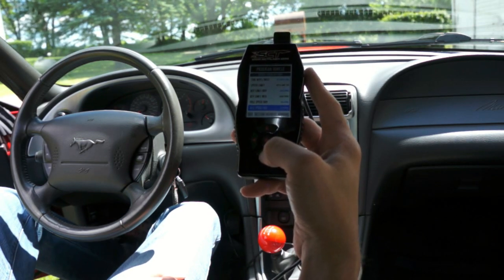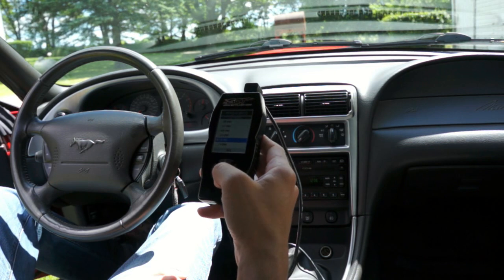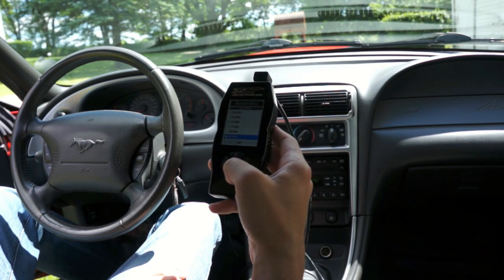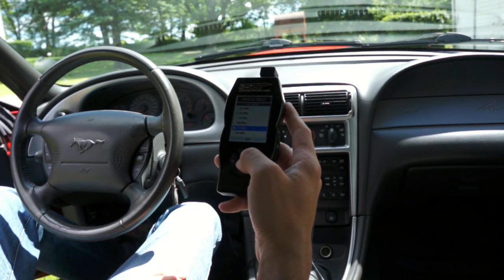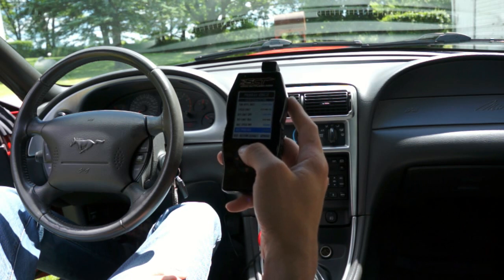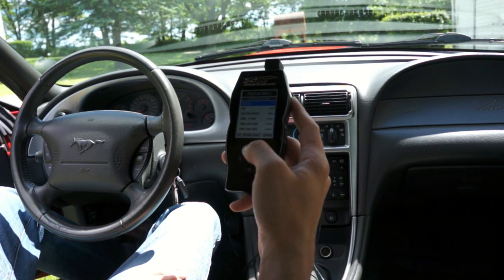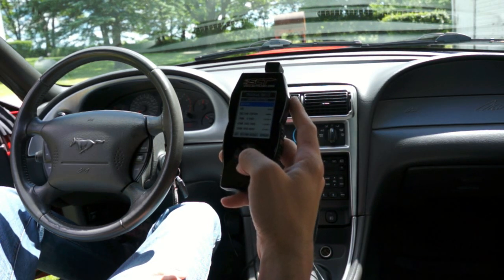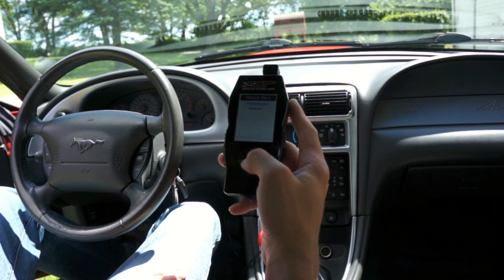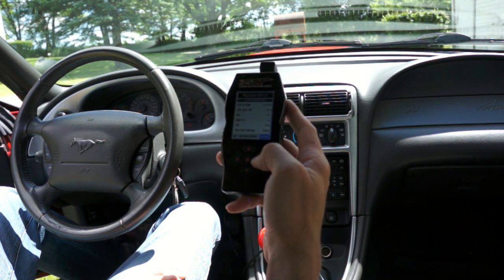We were able to bump all those up a little bit. Now I'll make a slight adjustment and bump up the idle speed in neutral — going to go 870 on that. I just want to get that a little higher so when you're cycling the AC on and off, it's not such a difference in idling. It also makes starting the car a little easier — not that this car has any issues with torque, but just with it being a manual it makes it feel a little nicer. We've loaded the car up with 93 octane, so we'll select that. All other settings are still set up here and now we'll hit approve.